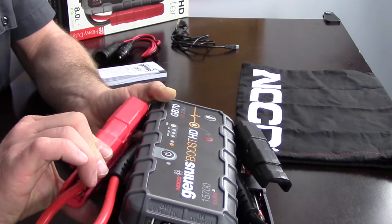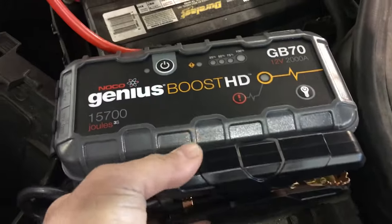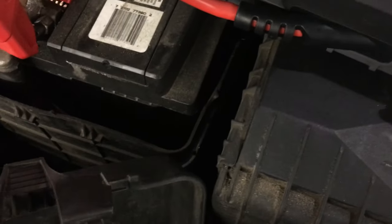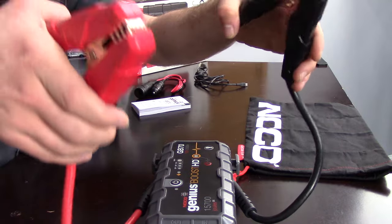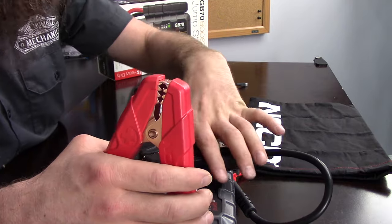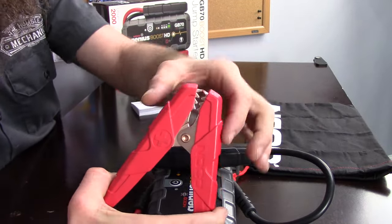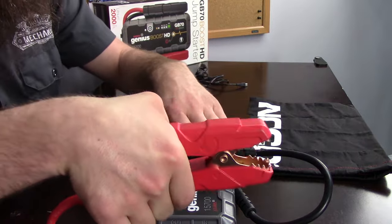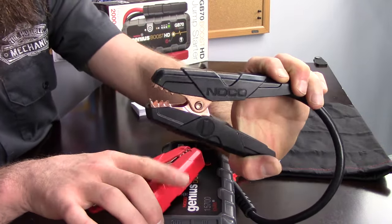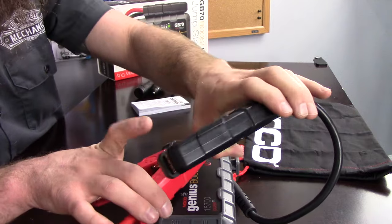The other thing that I think would be really beneficial to this jump pack is if the cables were just a little bit longer. You'll see in some of the videos that I struggle because these cables are really only about 10 inches. There are some vehicles, especially some Volkswagens, where that's just not enough room to really get on the battery and have this in a good position to monitor it. The other thing is the clamps are a bit bulky. If you work on batteries in really tight locations — especially like Volkswagen Beetles on the negative post — this is a little bit bulky to get a good, solid biting connection.